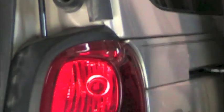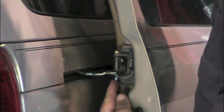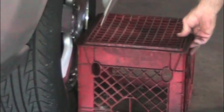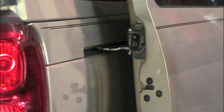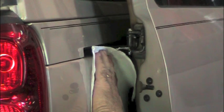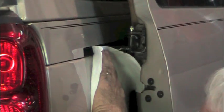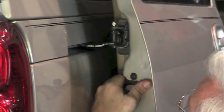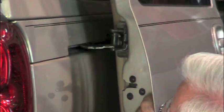It's not a very hard task getting this out. There's a little keeper on the bottom — you can just pop it off with a screwdriver. Then we need to drive this pin up, but the door is going to sag, so you need to get something like a milk crate or a five-gallon bucket at about the same height. Put a little towel in to protect the paint, then drive that pin up. Once the pin is up, lift up on the door and slide the pin out. Now the door is free — we can pull it out and set it down on the milk crate.